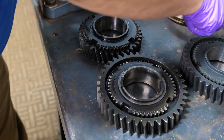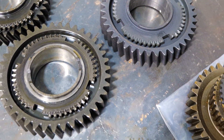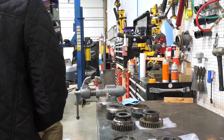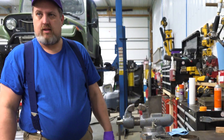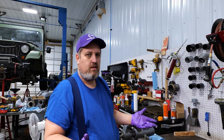You can look here a little closer at these ridges compared to these. Basically what we're seeing here is a transmission that was in mostly really good shape, so we're going to go ahead and go with that. The next step is I'll get these parts into the washer, get everything clean, and take one last look at them. That's a whole lot of back and forth when you're building a transmission, especially if you haven't done it a hundred times — making sure that everything you need is going to be up to spec.